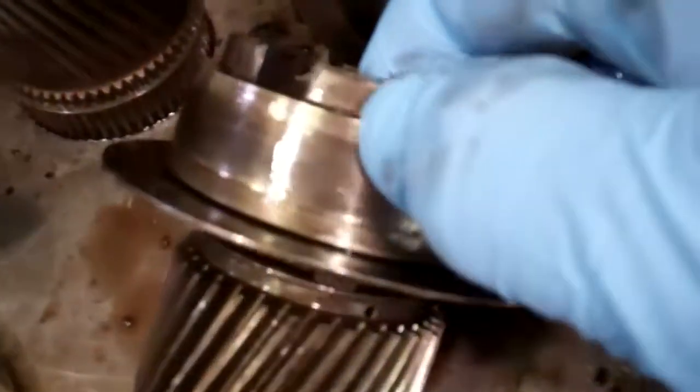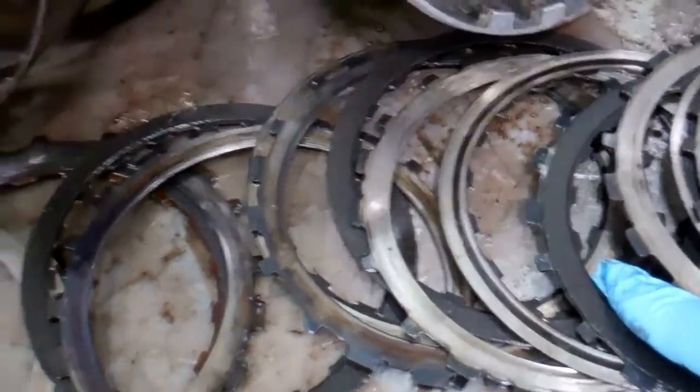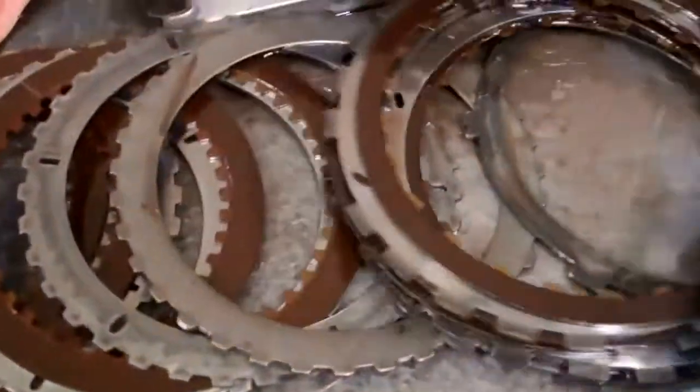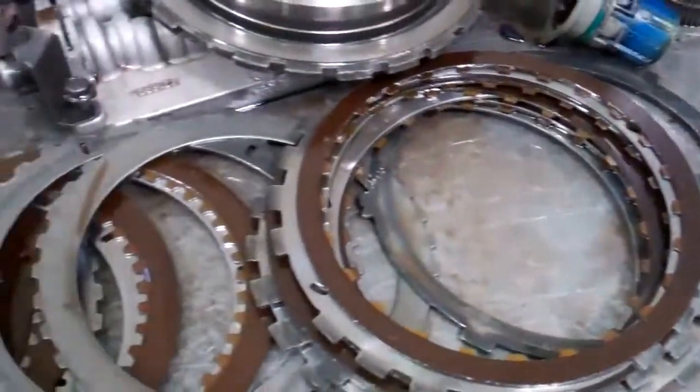You can see the grooves close up in there and how those pitted. In addition to that, you've got your entire forward clutch — three or four clutches that are burnt up. Your forward clutch is here. You can see these are starting to tinge. A lot of metal and friction went through this.